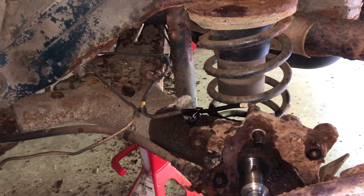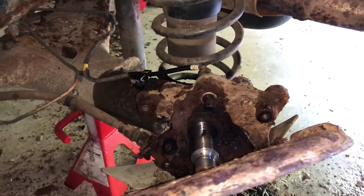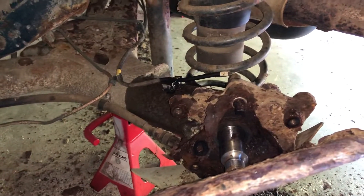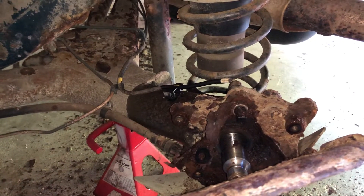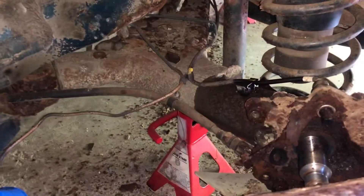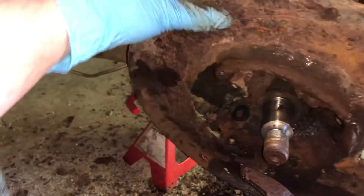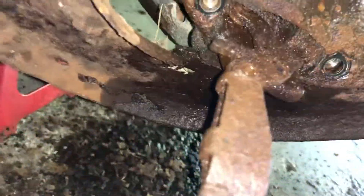That's where my day is. Hopefully before the mailman comes with my fuel filter, he's also got a new rebuilt caliper. I'll get all of these back on, bleed the brakes, and get the parking brakes back together. By the end of today, this car should go forward, go backwards, come to a stop, and if I pull the parking brake lever and put it in drive, it shouldn't go anywhere. I may need to replace this dog leg — hear how crispy it is.